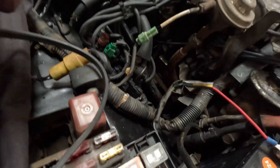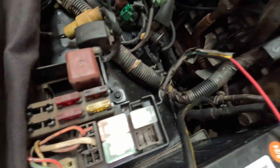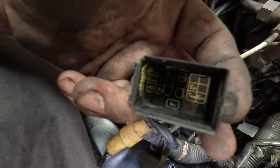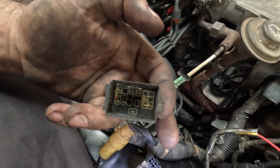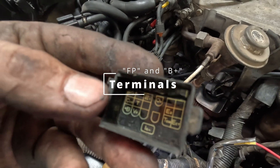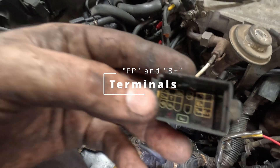You're also going to do obvious things like go over to the fuse box and look at the bigger fuses to make sure those are working. Then let's talk about the fuel pump. A really easy test: you have the diagnostic port right here. Look down in there and you'll see markings. The far left says FP and B+, meaning fuel pump and battery positive.